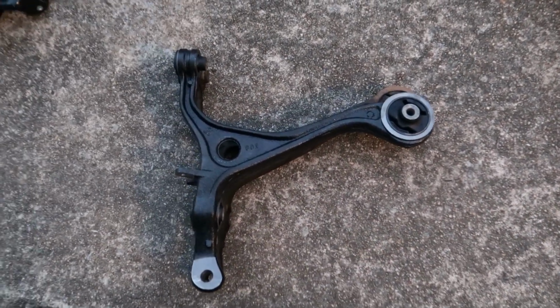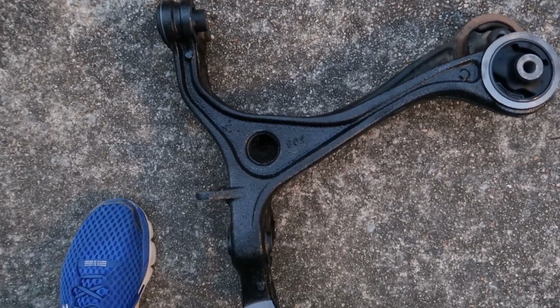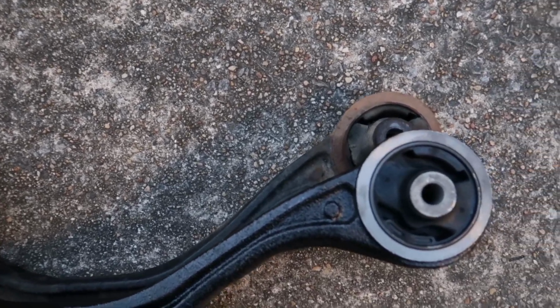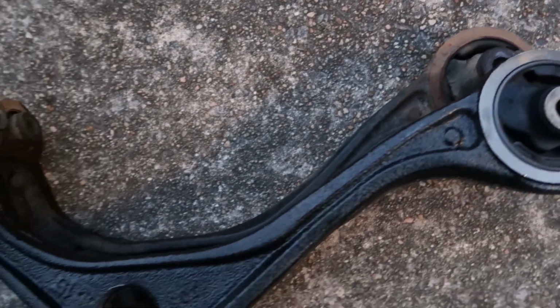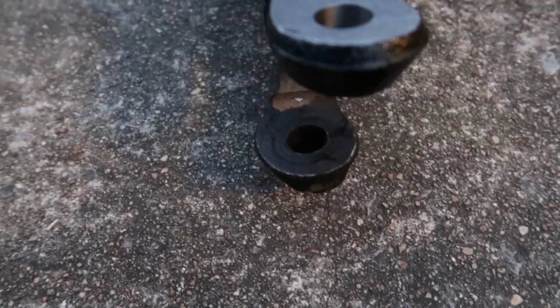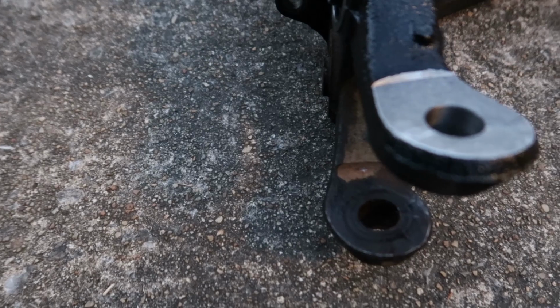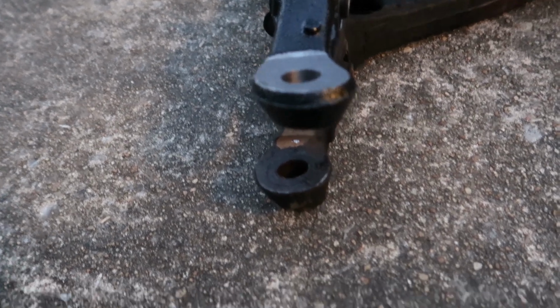The amazing thing was those guys from Pep Boys were right on the money. Check out the difference between the new and the old lower control arm. You can see the old one is on the bottom. The bends are amazing on this thing. It is completely off here. It's not even really close. It looks like it could be from another car because it's bent so badly. And this angle down here was so far off. I mean, it was bent down and bent back. It didn't really resemble the original control arm. The bends were so bad. So hats off to the guys at Pep Boys. They really called that one. It was bent all to pieces here.